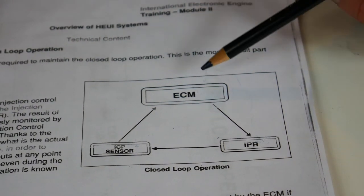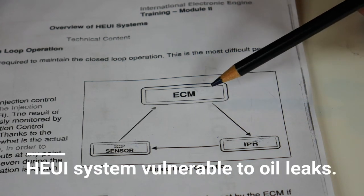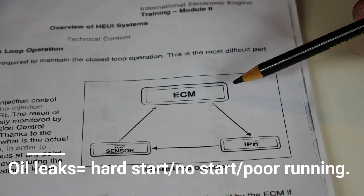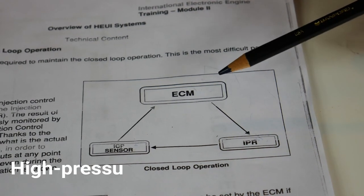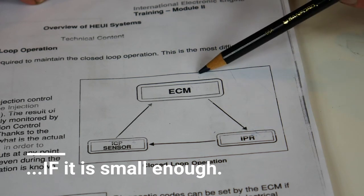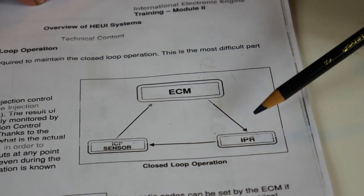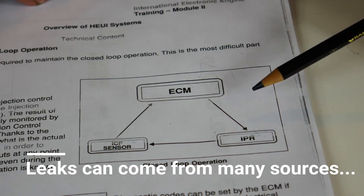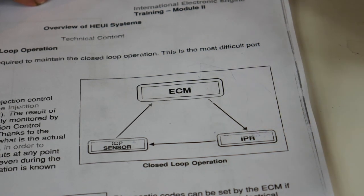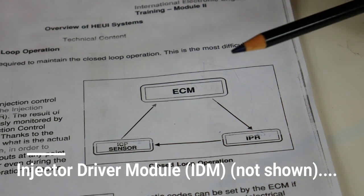You really must have a tight system for this to work — meaning it must be physically sealed. The O-rings and all internal seals have to be good. Any leak is like a ruptured artery. The high-pressure oil pump may keep up with a small leak, but if you have a large leak from a torn O-ring in the injector, lines, stand pipes on the 6.0, the high-pressure oil rail, injector nipple cups on the 6.0 — you'll be bleeding off pressure and the injectors simply cannot fire. High-pressure oil is what fires the injectors.